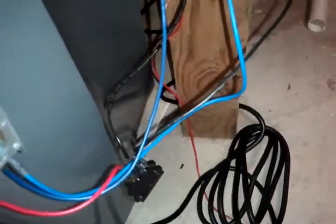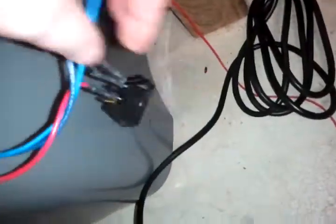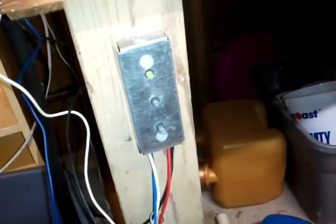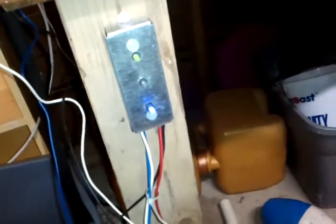And this screw right here — with conveniently no gauge to tell you what temperature it's set for — is the thermostat. I altered it some since I disconnected the heater. I made it so that the switch on the back can actually turn on or turn off the entire unit. That used to be the front panel, which is just lit up to show that it's on and cooling. Power applied, green light is on but not cooling — compressor's off. Blue light on means it's cooling.